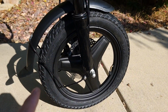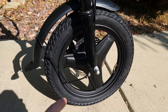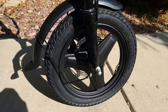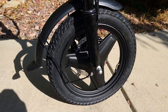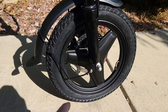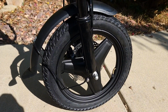And when you start to pump the air in the tires, make sure it's sitting very well, because if it's not sitting correctly, you may get your tube exploded. So pump air slowly, and it's good to pump with an electric pump if you have one. It will be very fast and easy. At the same time, you're gonna know exactly how much PSI you put. These tires are good at 35 to 45 PSI pressure, so make sure you check before you start to ride.